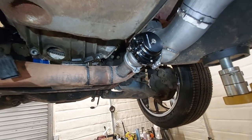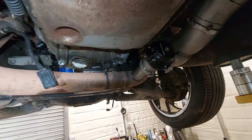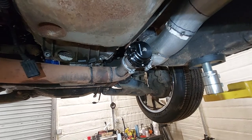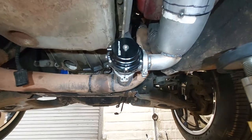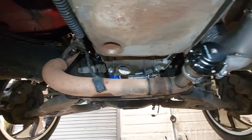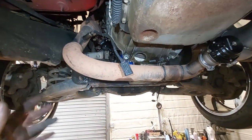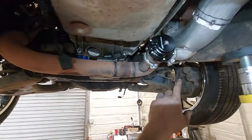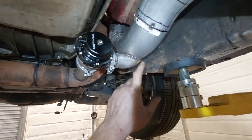It's not as loud when it opens, like it is on all my other turbo trucks. Turbo stuff always vents to atmosphere, but on this one I wanted to tie it into the exhaust so it's not as loud when it opens. Got that in and got it mostly welded — I'll pull it back out and finish welding everything on the crossover. I'll probably put a v-band here.